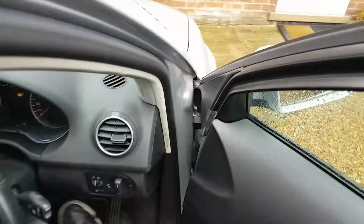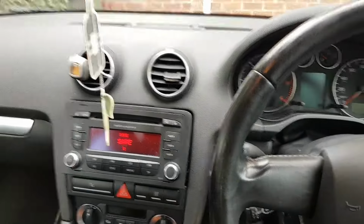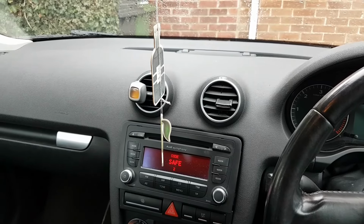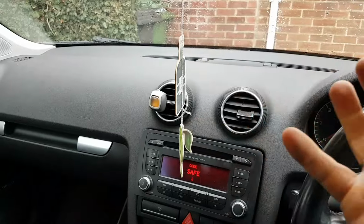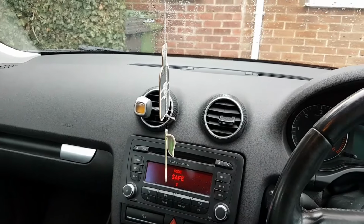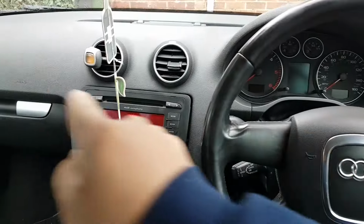And I know I said at the beginning that this was the 2 liter, but as you have seen now, it is the 1.9. My mistake. So that's what I've done. I just searched for a fuse that would have ignition voltage, so when you turn the ignition on it feeds the sensor. And then I grabbed the wire underneath. I dismantled the entire fuse box, spliced the wire in there, soldered it, all that good stuff, and ran a little wire up to the front. So I'm still feeding the fuse from ignition voltage, so everything is doing what it's supposed to be doing. And we just ignored the circuit inside.